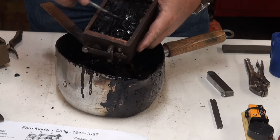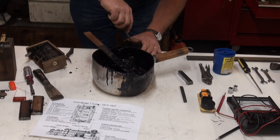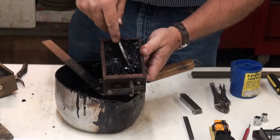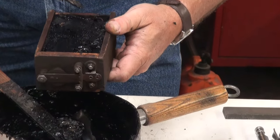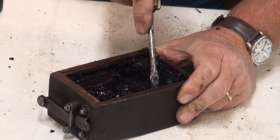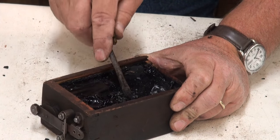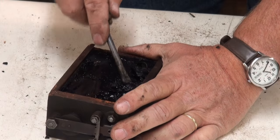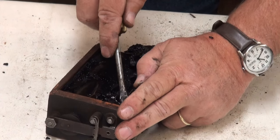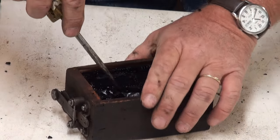And so knocking some of that tar out, we can already start to see the top of our old capacitor. But I still haven't located that wire yet. And there it is. It's going to run right up along the top of that glass insulator. Now if we get underneath that wire, like I mentioned before, and lightly pull up on it, you don't have to get a lot of strength on it, just lightly pull up on it, you can see it really aids in getting the tar removed from the top of this coil, or from the top of this condenser. But I don't get hard with it, just lift it up slightly, and that wire just breaks that tar loose.